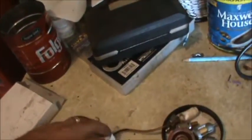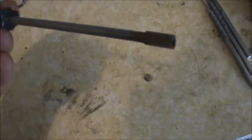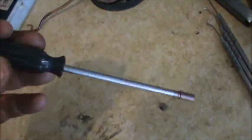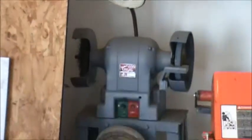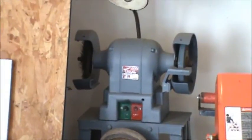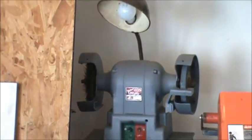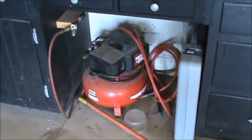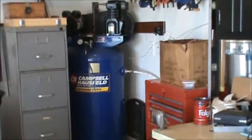These are more air filters for the Briggs and Stratton engines. This is a specialized tool used for adjusting two-cycle carburetors — I got that off eBay. Right there is a pedestal grinder with a light wire brush — great for sharpening blades, used all the time. You definitely want to have a grinder. You're going to want to have compressed air — you can start out small with a pancake compressor and as you graduate you can go on to something bigger.